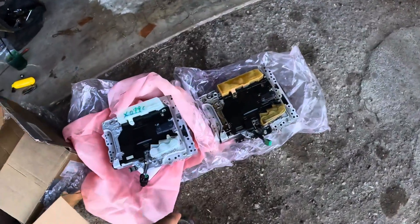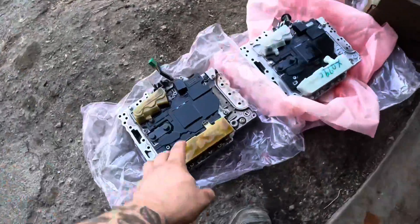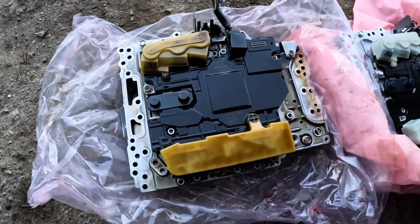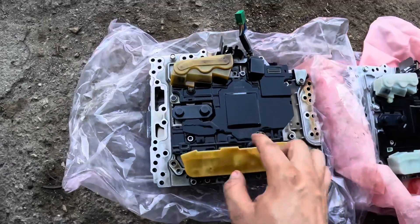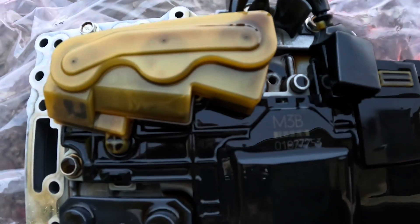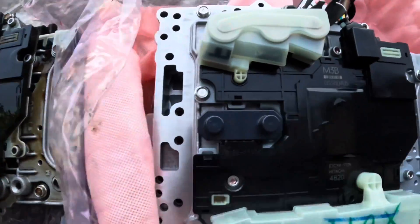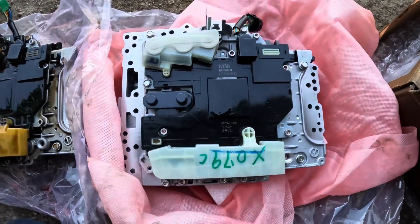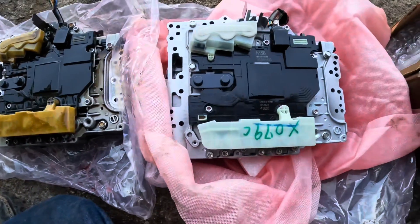I did take out the manifold and I'm at the valve body now. This is the old one that was already in the car — you can see it's kind of wasted, already gone. So you always want to make sure these numbers are M3B match. The other one's the same thing — M3B. This one's brand new. You can tell the difference from old and brand new.